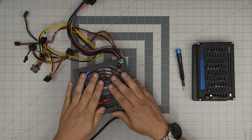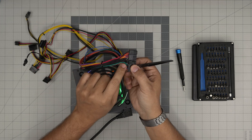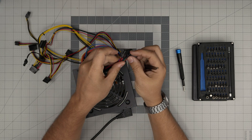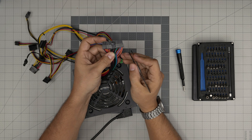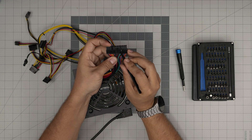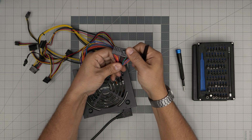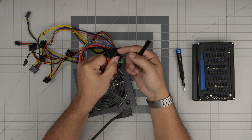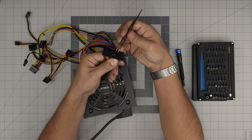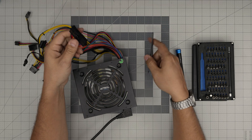You hear that noise? It's really annoying when your room is quiet. Now for a non-colored 24-pin connector: you want to look at this hook on the connector — face the hook toward you from the right side and count one, two, three, four. The fourth one is the green one. So you want to short the fourth one with the third or with the fifth one. With most power supplies the cables are all black, so count from the right with the jack connector facing you: one, two, three, four — then short the fourth one with the fifth or the fourth with the third. That way you can power on the power supply.